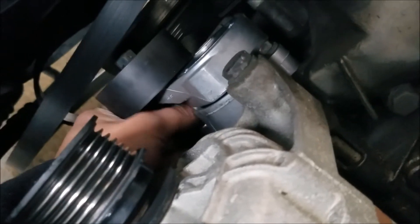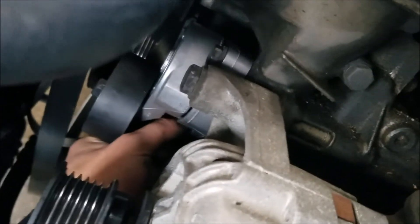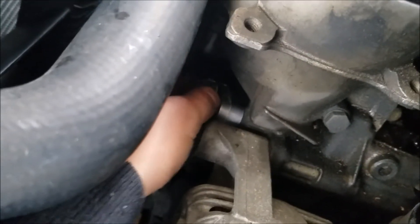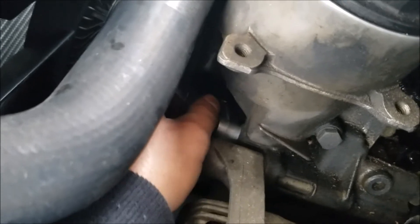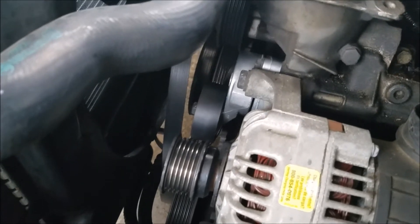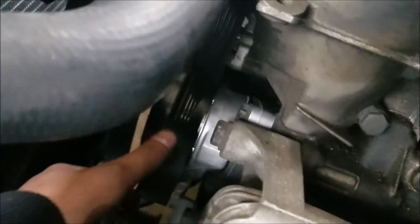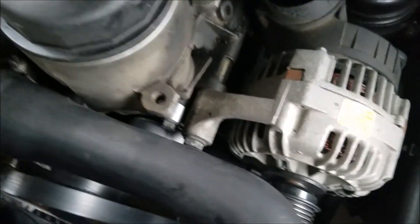Installation is really easy — just mount the tensioner back up and get your studs hand tightened. The most difficult part is getting to that bottom bolt; once you've got that it's a piece of cake. Also, while you're at it take a look at your belt. If it's in good shape keep it, but if it has a lot of cracks go ahead and replace it. I just replaced this belt about six months ago so it still looks pretty new. I used a wrench — a 13 millimeter — for the bottom bolt, and the top one was easy.